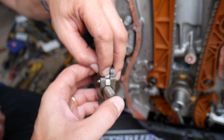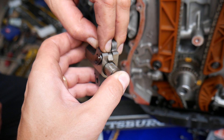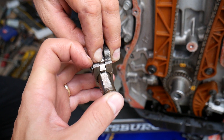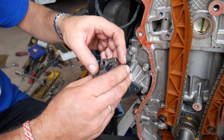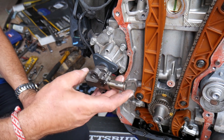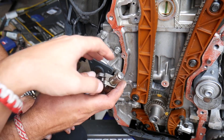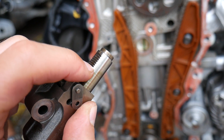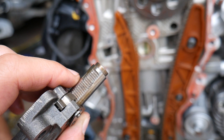It also has an oil seal inside that can fail, and the spring can get soft over time. You can see that spring — it shouldn't be so soft. I can compress it pretty easily. And those teeth — if they get worn out, you're done; you can jump the timing. I'd recommend not going over 100,000 miles on these. Look at that shiny spot right here — you can see that shiny worn area, and the one on the other side is worn out too.